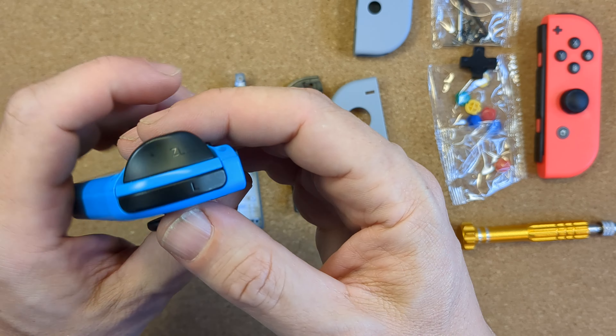After this I went to great pains to try and remember which holes the two screws went into — just do it like I ended up doing here, it is in the right spot. Locate the infrared camera in position and put the rumble motor back in its slot, pushing it firmly in place. Then put the joystick in — this time I did the stick first and then the ribbon, using tweezers to put it in place and clip it down, then put the two gold screws in to secure the joystick. Now the two ribbons need relocating to attach the rear shell — insert them both and clamp them down. Next the shoulder button goes in place, followed by the mid frame and its ribbon, which I find to be the hardest part of this whole process. I found it best to grip the ribbon with tweezers, let the frame hang to one side, put the ribbon just into the slot, then put the whole assembly down and use the tweezers to push the ribbon in place and the spudger to flick the catch down until it finally secures flat.